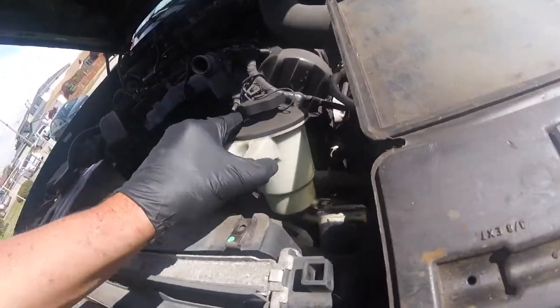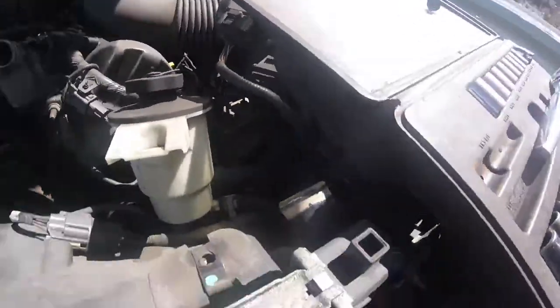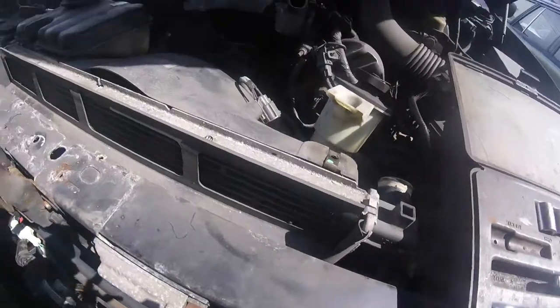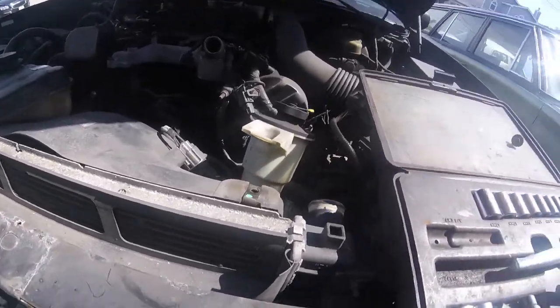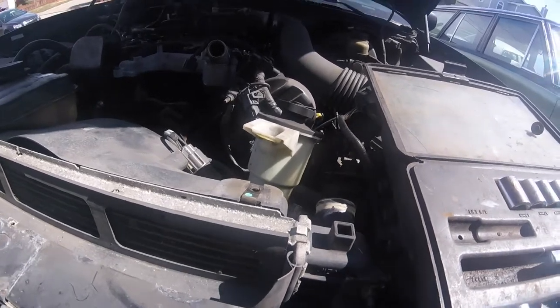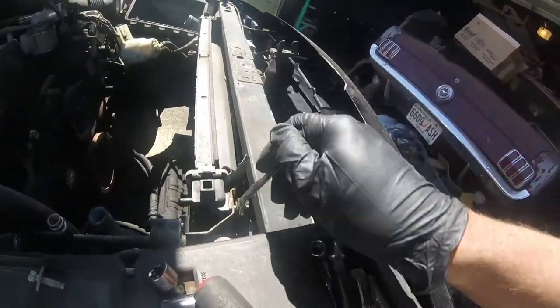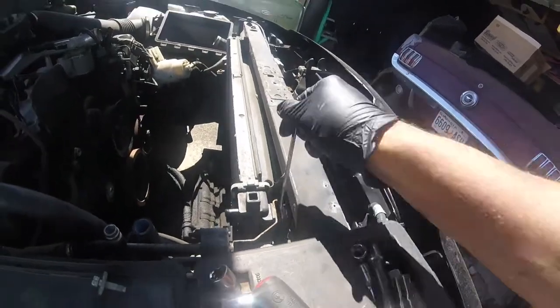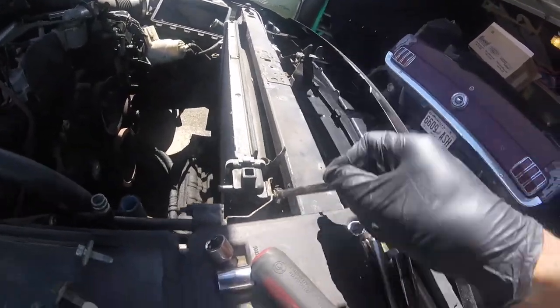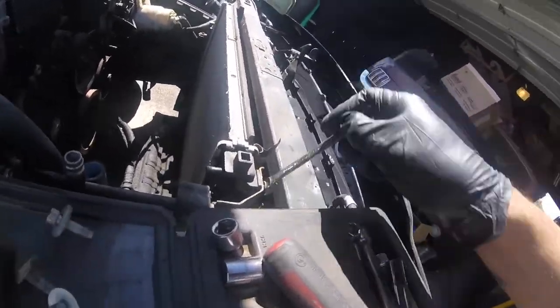Alright, I'm just pulling off some of these accessories here. The pain in the ass thing about this car is that it's a combination of metric and standard. Because it was a government fleet vehicle, they wanted to do everything metric, but half the stuff is still standard. So real pain in the ass. Same operation a couple steps later and we're over to metric. Fan shroud is 5/16s and radiator is 10 mil.